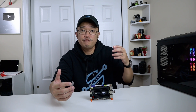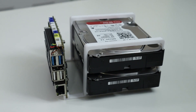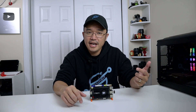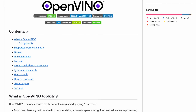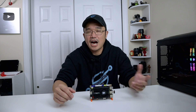The hardware is the same as most NAS systems you find these days, with a very reasonable price tag. I also designed a simple NAS case that allows you to vertically mount SBCs like this one or a Raspberry Pi along with two 3.5-inch hard drives. There are a few other dev boards using similar CPUs, like the LattePanda Delta, Odroid H3, and an Intel board called the Alex board — which notably mentions the OpenVINO toolkit made for AI, enabling things like stable diffusion and object recognition.